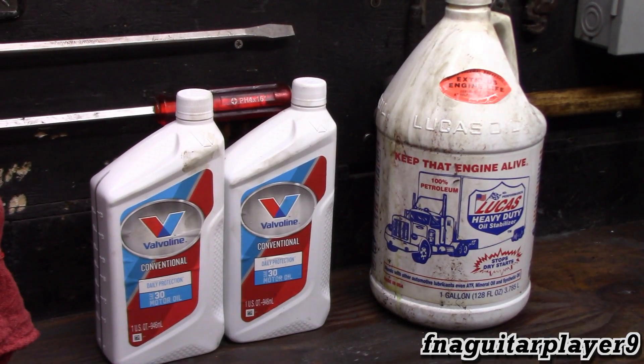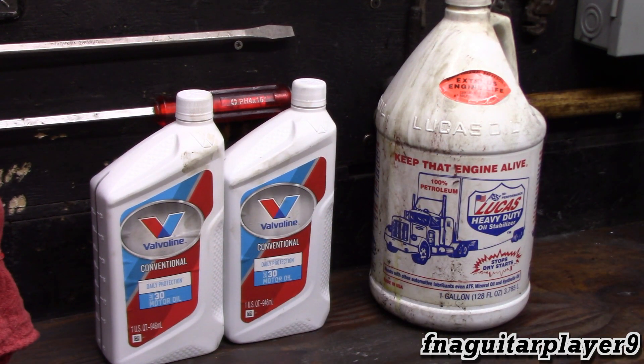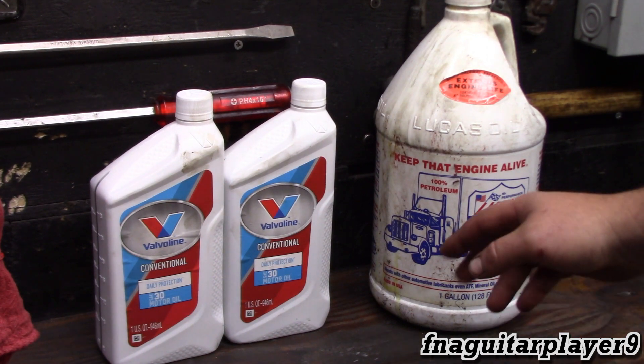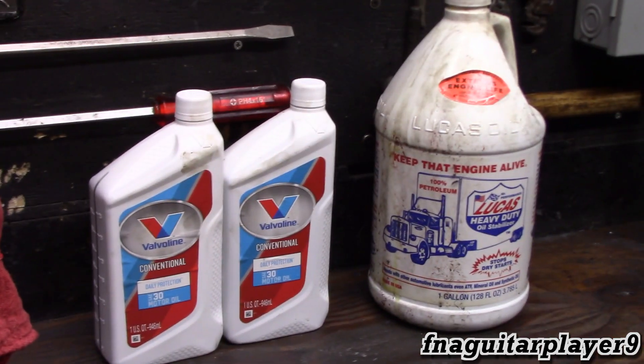I'm not going to get into a whole lot of detail about brands, but I'll talk briefly about what I've been using. I've been using Valvoline SAE 30 and Lucas. You want to follow your manufacturer's recommendations for oil weight — a lot of small engines are recommending 10W-30 now, so pay attention to what your engine manufacturer recommends. This is an old flathead engine, and flatheads run a little bit hotter, so I like to use Lucas to help keep the oil from thinning out. This seems like a perfect combination. I'm not sponsored by any brands — I buy all the stuff myself.